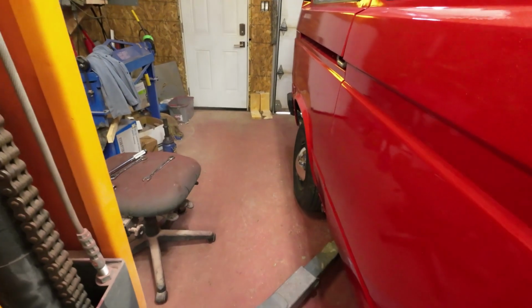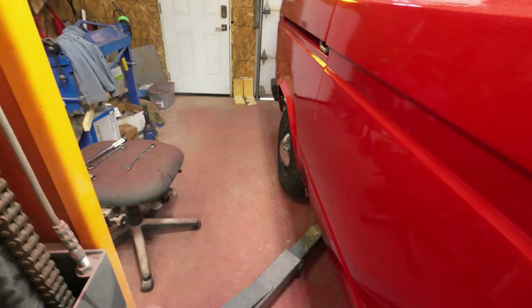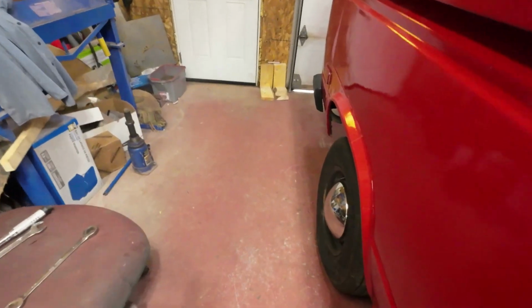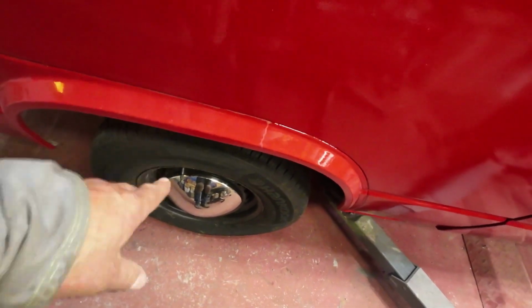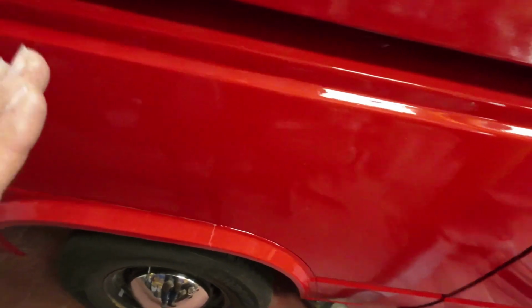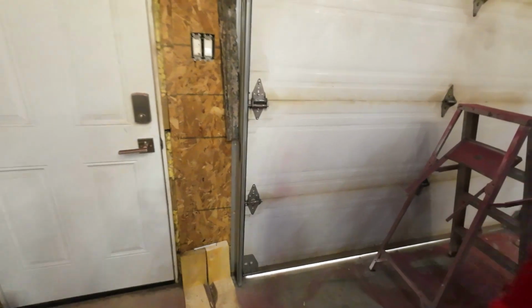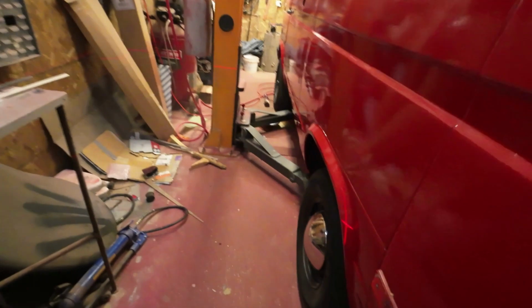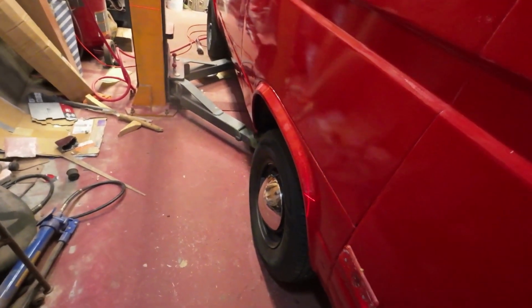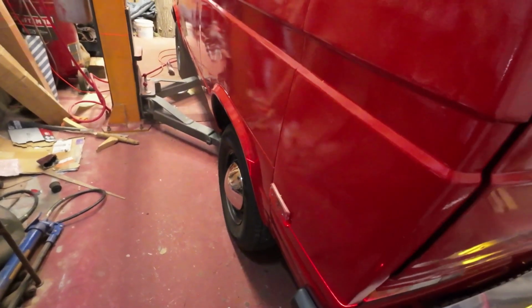Yeah, so their camber on the back wheels now is adjusted. Both of them are the same, 8 millimeters. The bottom is 8 millimeters. The top is 8 millimeters farther in than the bottom. So they go like that, right? By 8 millimeters. Now, the things are the negative 0.5 degrees or 50 minutes or whatever it is there. And what's negative? I don't know, plus or minus. But it won't go the other way, so that must be what it wants. Anyhow, it's 8 millimeters. They're good.